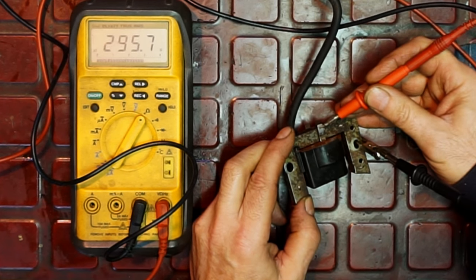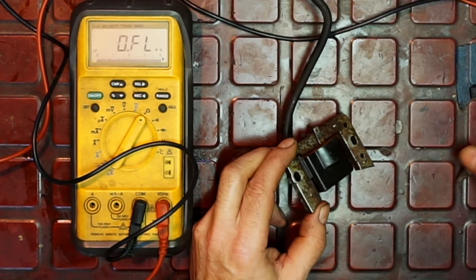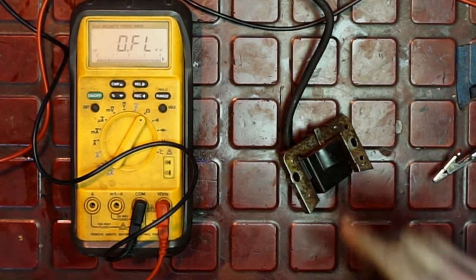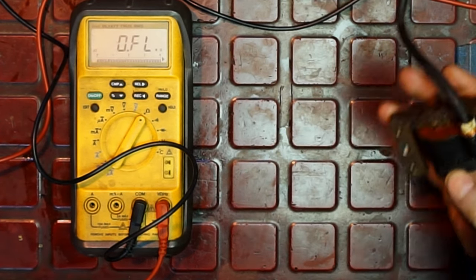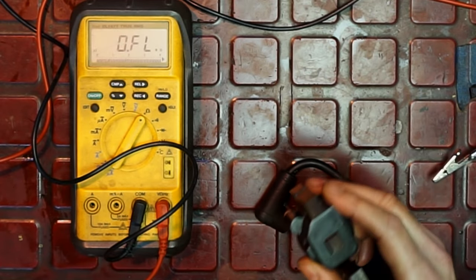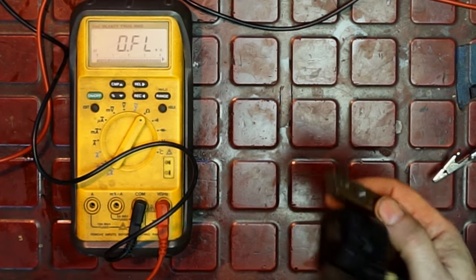Let's go from the body of the coil to the secondary plug wire. 4.2K — 4.26, 4.24 — that's not bad, just a little over 4,000 ohms. And we'll go here: 296 — that's about right. I'll actually have a video out soon where I've measured all of these different kinds of coils and all the top manufacturers we typically use — probably out mid-winter around February.